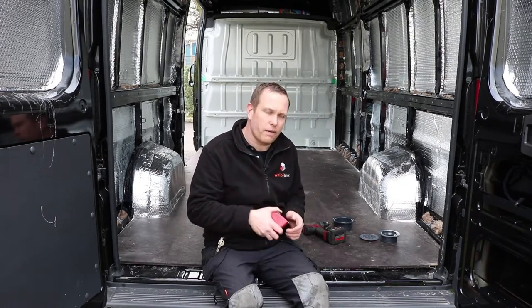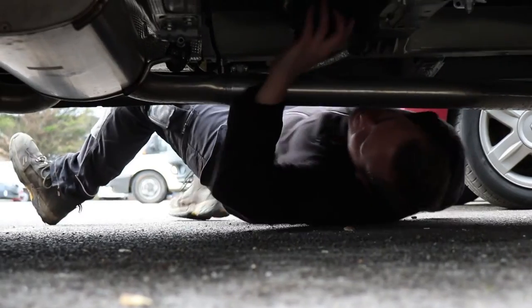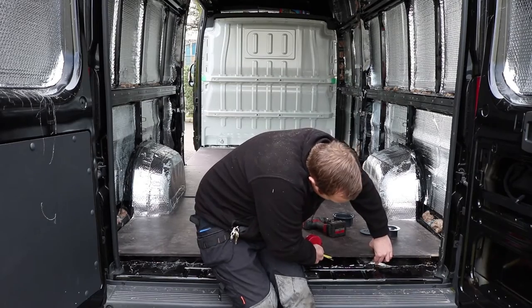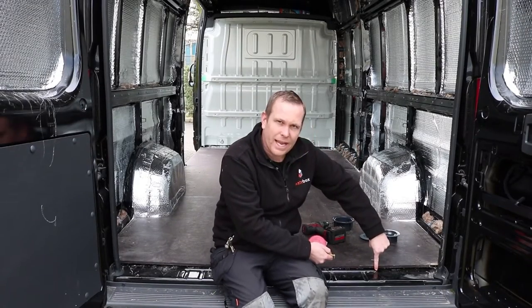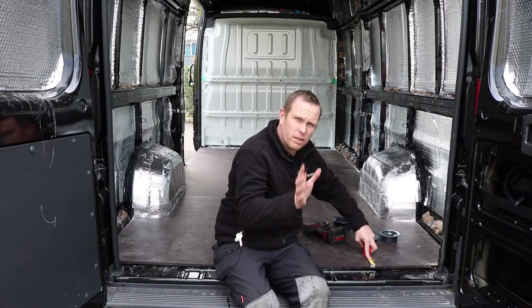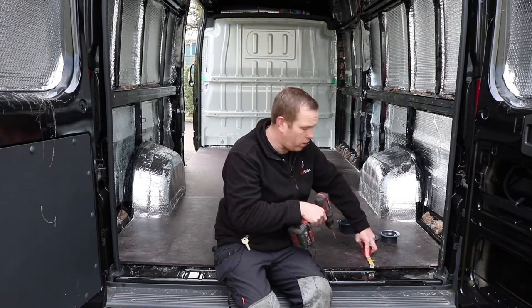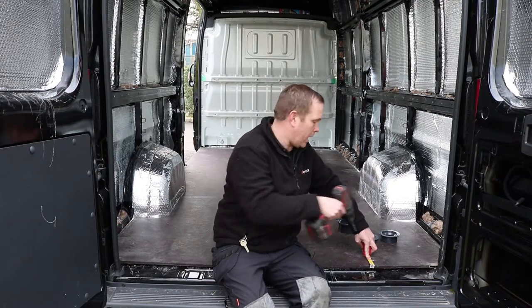Best thing to do is have a look underneath and work out how far the vent has got to go in. I know I've got to be 70mm from this point. I can see on the base of the van there are these ribs that run all the way through the van. Using that as a reference point, from underneath I'm going to measure 70mm back because I've already checked that measurement. And then I'm going to drill a 6mm pilot hole first. This is going to make sure that the floor — the top part of the floor — aligns afterwards with the hole that you've cut underneath, because the last thing you want to be doing is cutting holes in the floor and then nothing lining up.